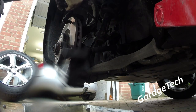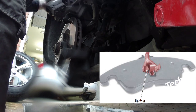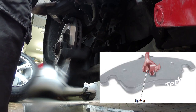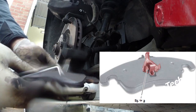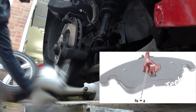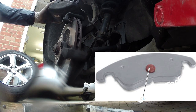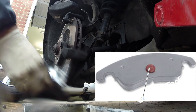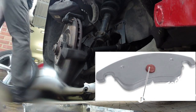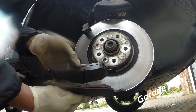Once the plug is off, you can start to remove the pad — I always remove the one closest to the piston first. You can see on the picture there's a spring clip and the sensor. Then you can remove the other pad on the backside. You might need a hammer or large tool to give it a bit of a whack because sometimes it's a bit stuck. It's got a little locating pin which sits inside the caliper, so you can't fit the pads the wrong way around.